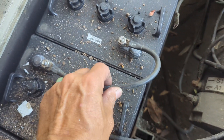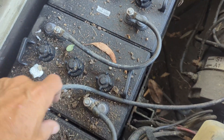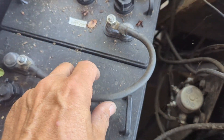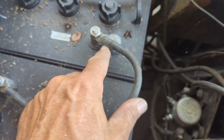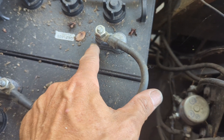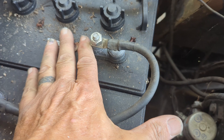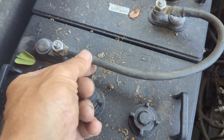If you're installing your golf cart batteries and you have cables that look like this, what's going to happen is you're going to melt this terminal. Because this cable is going to get hot as the amperage tries to pass through there, and this terminal's lead — it's just going to melt and pour down.